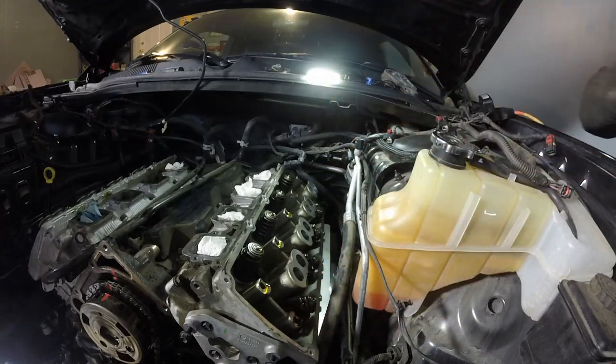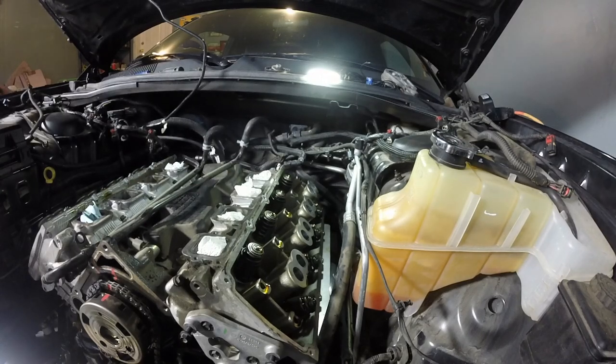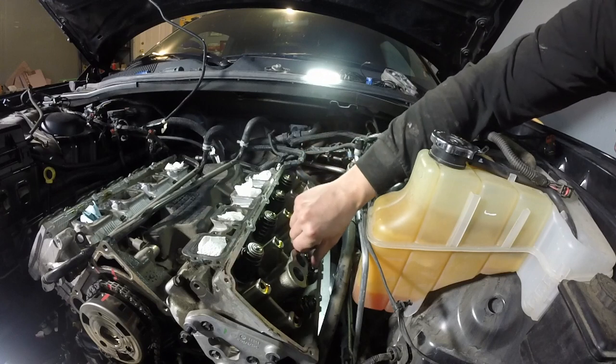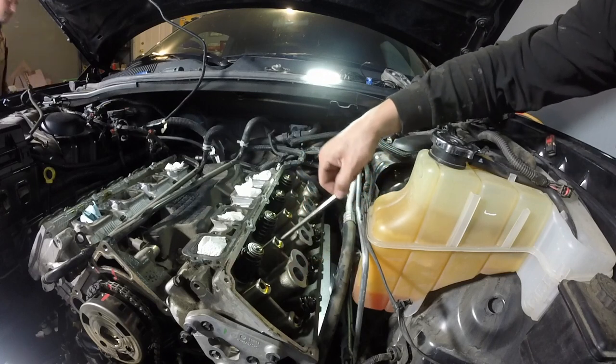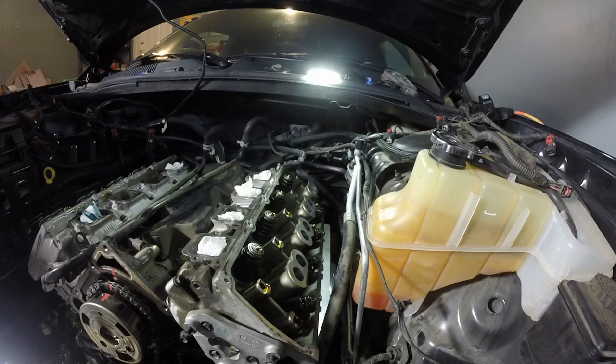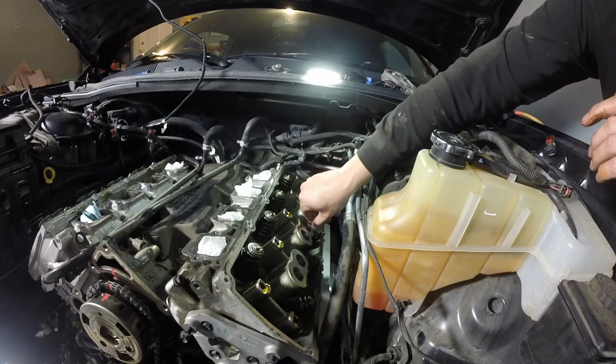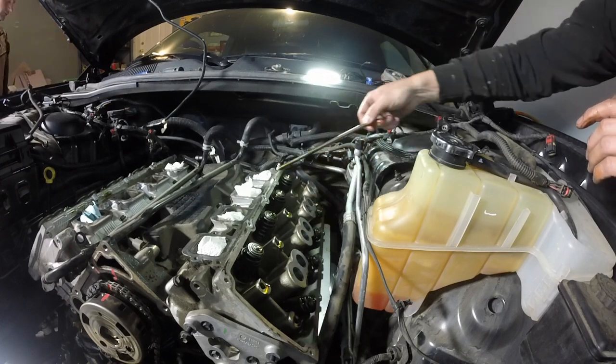First rod, these ones have a little bit of oil on them. So these guys have a hollow design, eh? So that's for the oil to shoot up and through to lubricate the rocker shafts. Right. And to keep lubricating the valves as well. The lifters, I mean, sorry.